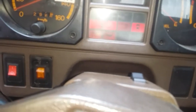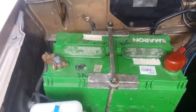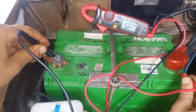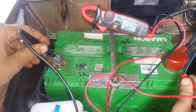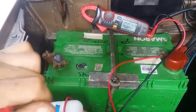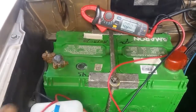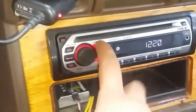Now I will show you the difference when it comes to checking your battery voltage immediately after you turn off the engine. We'll check our battery voltage now and it's giving us a reading of 13 volts. That might lead you to believe that you have an overcharged battery, but that is not necessarily so — that is only surface charge. That is why you need to leave the battery be for at least overnight, or if you want to speed up the process, turn on your lights and your audio system.